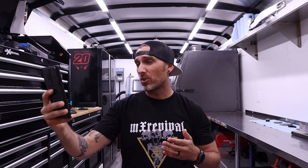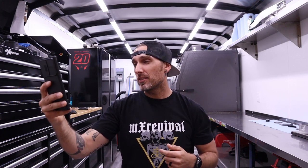Here we go. We are releasing a full billet carburetor for 125 through 300 two strokes. These will come in 38 millimeter and 39 millimeter taper bores. The 38 millimeter bore is an improved H-series bore design that flows more CFM and higher velocity across all throttle positions. The bottom end grunt is ridiculous. Yes, that turned out to be very accurate. The 39 millimeter is made to be the baddest peak horsepower carb there is. They've got a pretty good track record, so I'm gonna go ahead and say that there's a good chance that is absolutely true. The carburetor you'll be receiving, me, is a 38 setup for a 250 to 300 cc, 2004 RM250. Performance, nothing comes close.